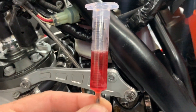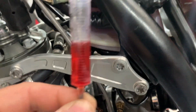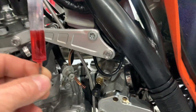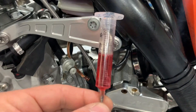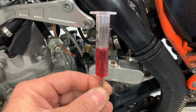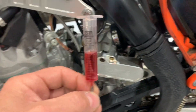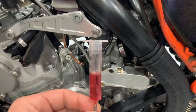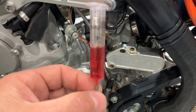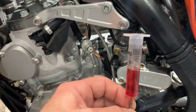So you can use this. This pump — this bike is in perfectly good condition and the oil pump is working properly. I'm going to test that periodically, and if I notice that changes — drops from three down to say 2.5 or whatever — I know I've got an issue developing with my pump. Maybe there's a bit of grit in there, something that's stopping or reducing the flow. With the TPIs, I have seen a number of bikes where the oil pump will still work but appears to be pumping out a much lower volume than it should. Using this oil priming sequence is just a good way to periodically test and take notes — write down the volume you get so you can compare what your bike does the first time versus what it does 20, 30, or 40 hours later.